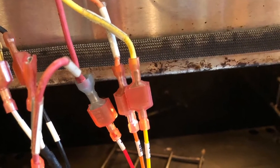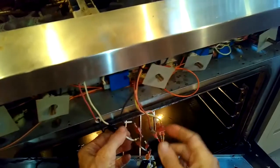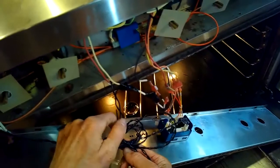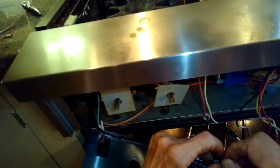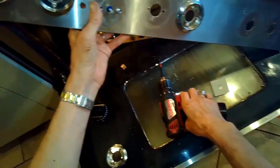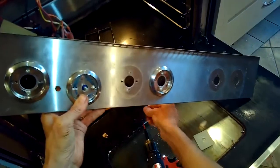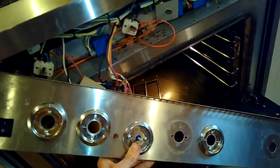This is what the wires look like - again it's pretty simple because it's all color-coded: yellow to yellow, orange to orange, red to red, black to black. The white one we had to adapt and take power from that LED circuit over to the left. Now we got it zip-tied. We're going to put everything back into this little cavity. This is how that little bezel goes on the front of the thermostat - you put in one of the screws, put the bezel on, and then put in the second screw, and just get it centered best you can.